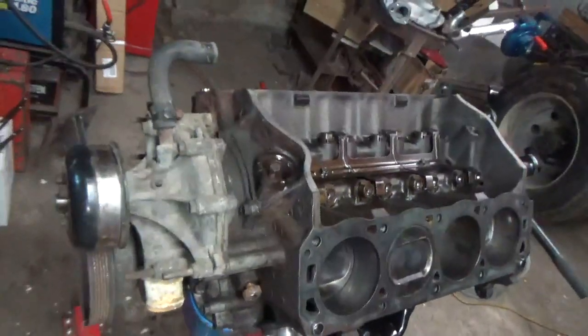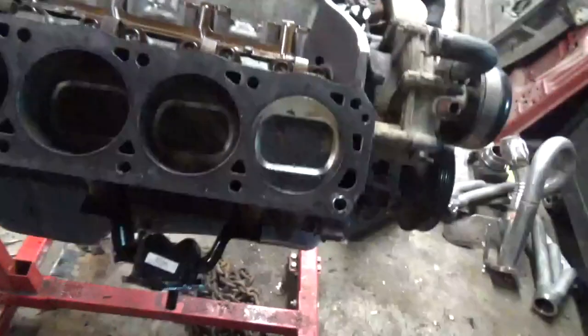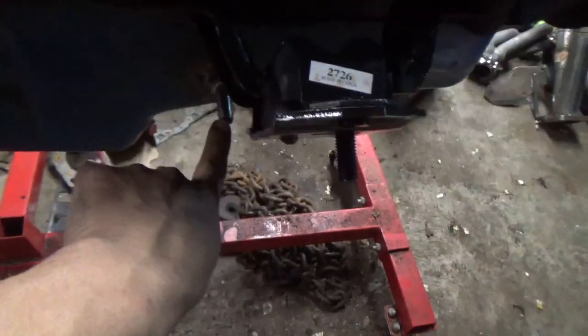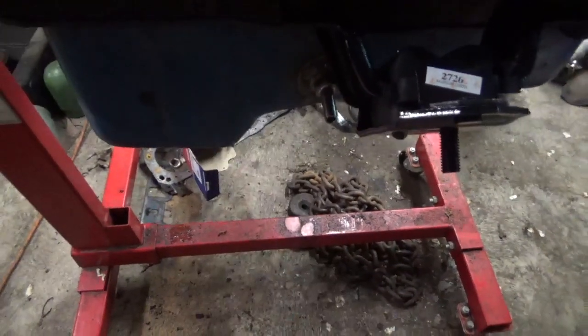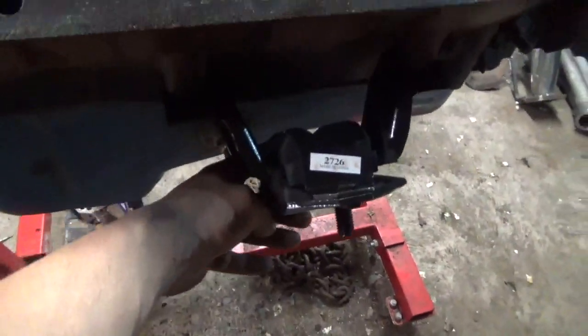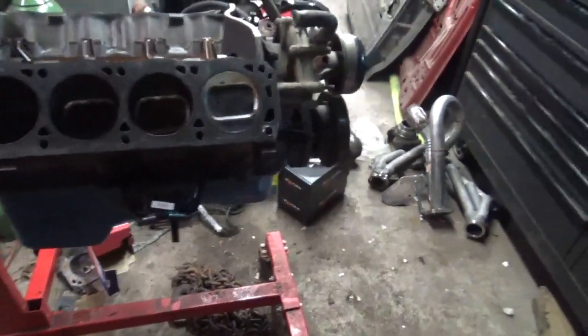You can see the top end is missing, so that means we've done some tear down. The new engine mount — this is going to be close, but I think that's going to go underneath the K-member, so hopefully keep our fingers crossed that'll fit. If not, I'll have to pull that out and put a 90 degree fitting on to go up this way and into the turbo.